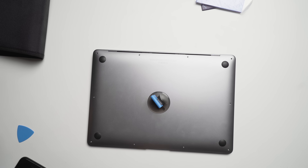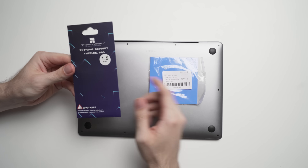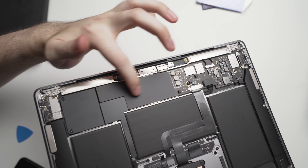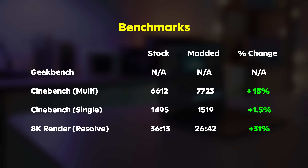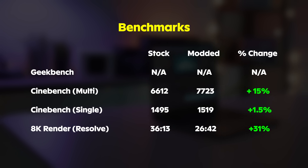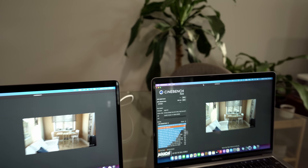Quick background: if you aren't familiar with the mod itself, it's essentially a thermal mod. All you have to do is take off the back covering of the Mac, apply some thermal pads to the CPU and GPU heatsink ensuring to make contact with the back metal chassis, and from there you can get anywhere from 5 to 20% performance gains in some tasks. I'll have all the links below to my original video and also a video showing you how to do it if you're interested.